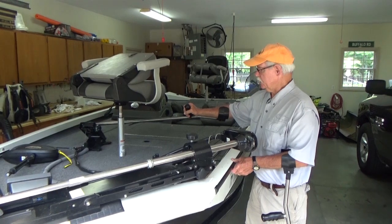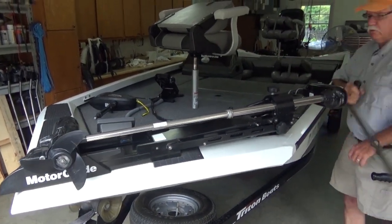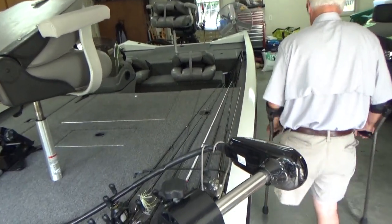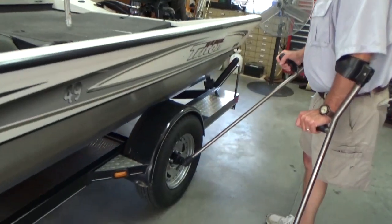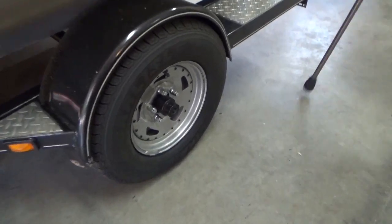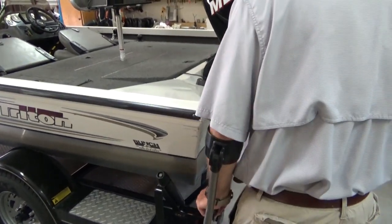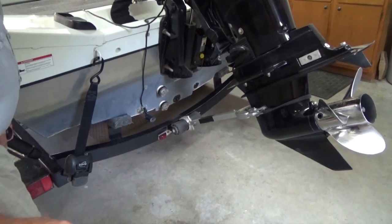Of course many of you don't have a crutch, but I reach across the deck and hit my battery or my foot pedal just to make sure I've got power there. Then I check my knobs on my trolling motor, make sure everything's secure. My fishing rods — they're strapped down and secure. I come back and check my tires, they're up. I check my buddy bearings — I can see it's kind of puffed out so I know it's got a good set of grease in it. I come back and check my transom tie-downs — they're good and snug.